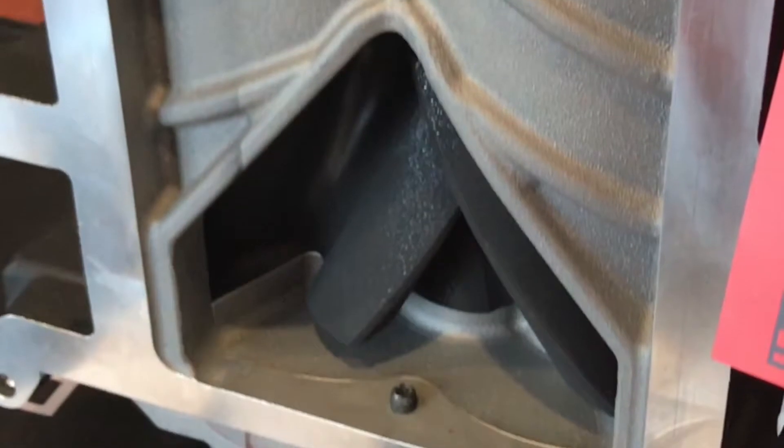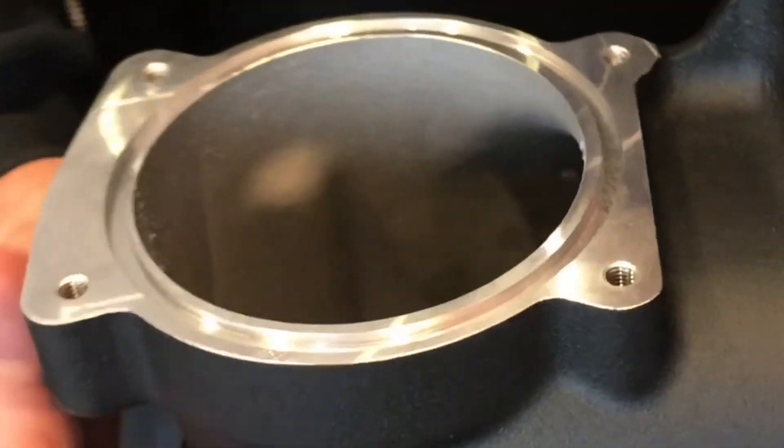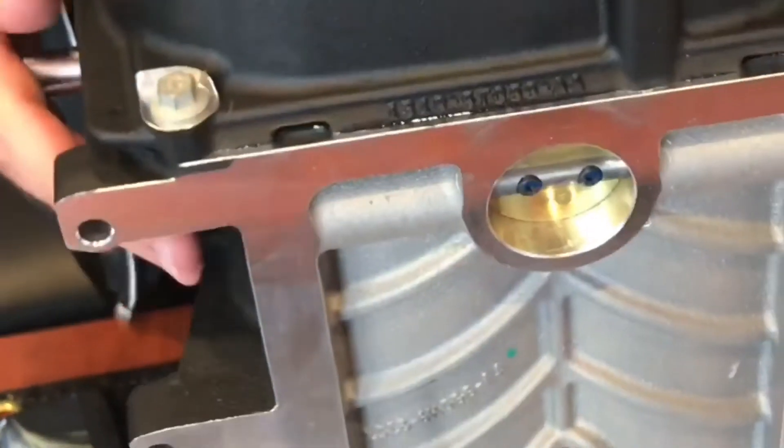All right, so the 2650 rotor geometry has better sealing. You actually have 170 degrees of twist, where you only had 160 degrees of twist on the previous generation model. The casing is all custom, all aluminum, and it's got a high-efficiency intercooler in it.